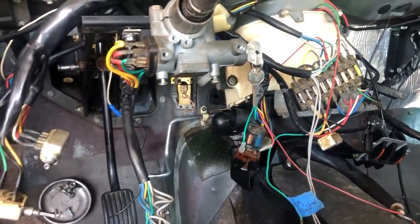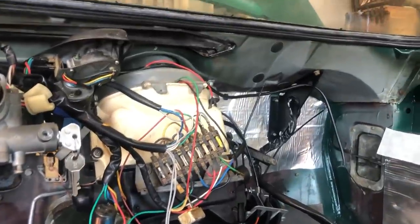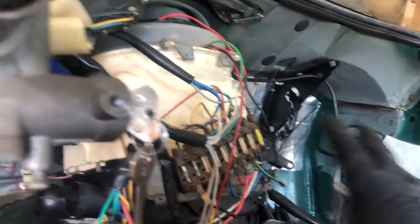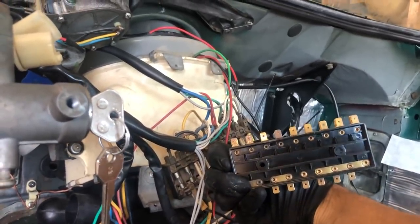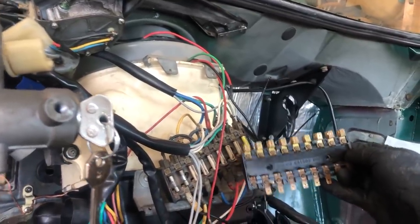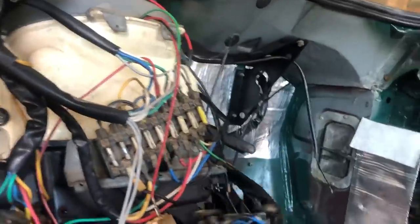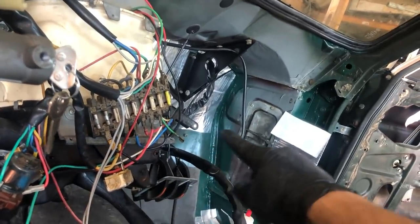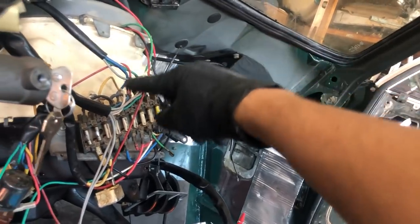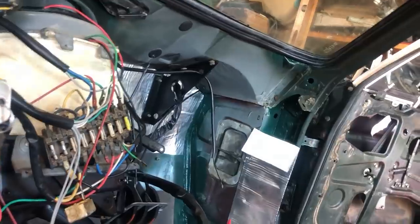I have swapped over all the switches from Amy, except for the turn signal and the hazard switch — I worked so hard on that that it's mine now. As far as the fuses go, there's the big harness coming out of the firewall. Over yonder, that's the relocation fuses. I have Amy's here with the exact same part number — 681502, Volvo Imperial. And there's the back side of them, which shows you the different routings of the input side. So now it's the opportunity for me to go through all my old photos and connect all of this the way it's supposed to be, and then splice it in. Essentially, it takes the input and sends it out to the fuse box, and then brings it back to the top here, so the fusing is all done on that side.